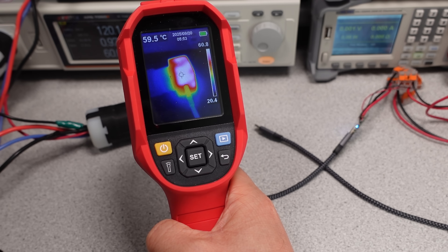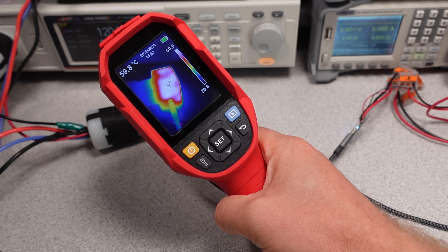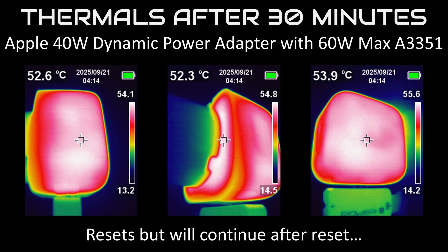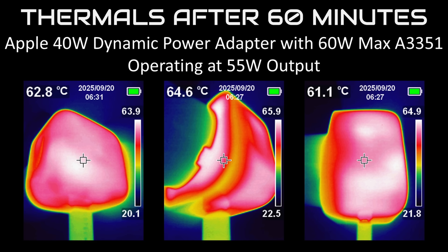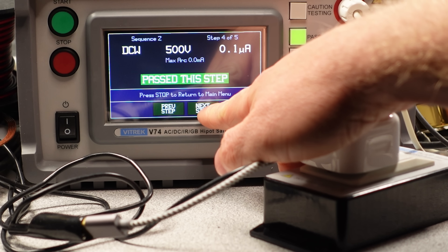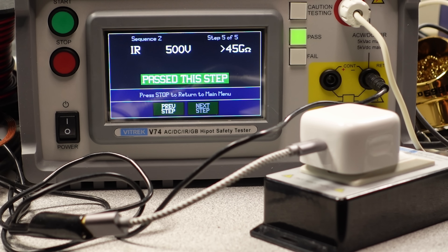In the thermal testing, this device had some interesting performance. It's fine at 40 watts — it claims continuous and it meets that claim. Things get interesting when you crank the watts up. At 60 watts, it got warm but not what I would call hot. The device will shut off like a clock at 30 minutes — you can restart it though, so it doesn't look like it's thermal throttling. I tried it again at 55 watts and it allowed the adapter to get a lot more hot, but it did stay on this time. The reality is your devices aren't going to use 60 watts all the time. In terms of isolation — the thing that separates the dangerous mains side from you on the low voltage side — this does excellent. The adapter is among the best in class for leakage from the AC side to the DC side, and this is consistent across all of Apple's adapters.